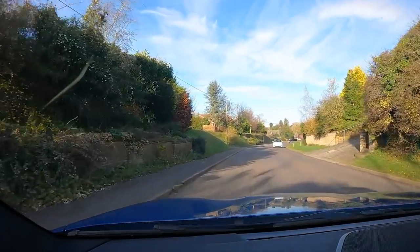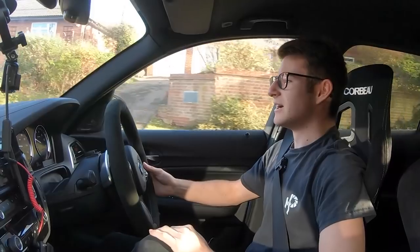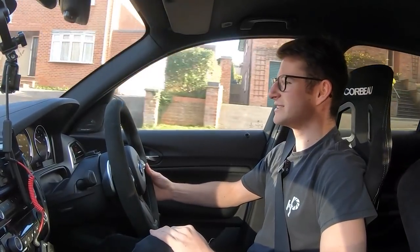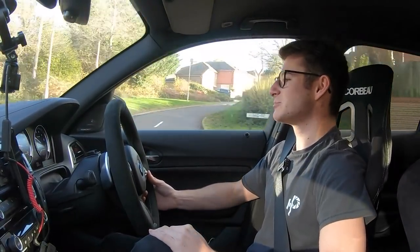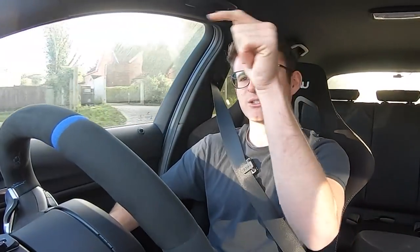Now, the guys up at Motec, of course, are good friends of the channel, and we've been up there a number of times in my ownership of this car. They've done probably over 500 of the Stance kits, be it the standard Stance or the Stance Plus. For those of you interested, the Stance Plus, like I mentioned, is 30 at the front, 25 at the back. The Stance kit, the slightly higher kit, is 25 at the front and 20 at the back. That, as standard, does come with 12 millimeter spacers up front and 15 at the back, which is what I was running initially, but when I put the different wheels on it, I didn't need them because the fitment was pretty good anyway.